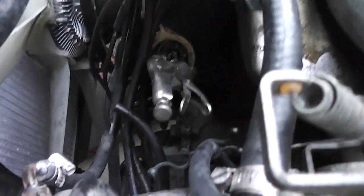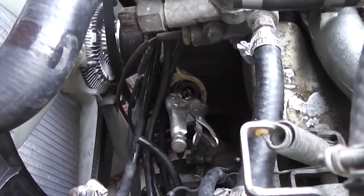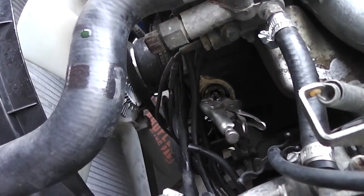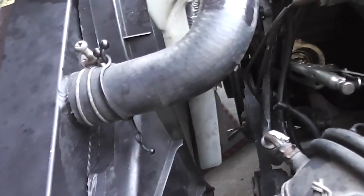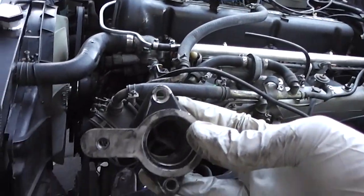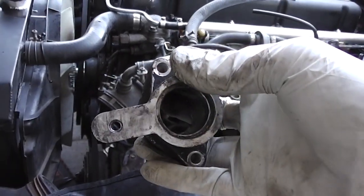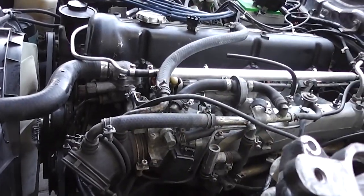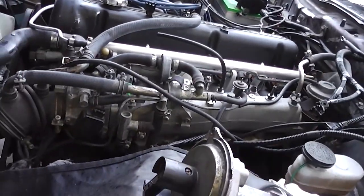The turbo shaft is in. Without the oil pump in place it would just fall out, so I have needle-nose vice grips holding it in position. I've got it lined up with a mark I made on the radiator hose, matching where the other distributor was. The two distributors sit differently — on the non-turbo version there's a bracket with one screw to adjust timing, but the turbo unit mounts directly to the front cover, so it sits a little lower.